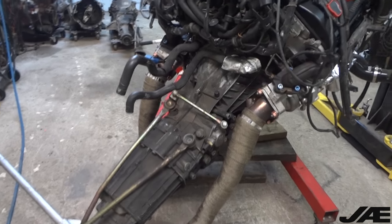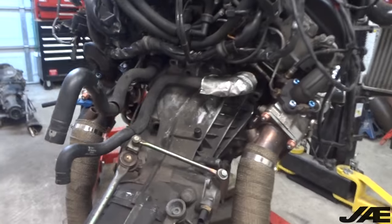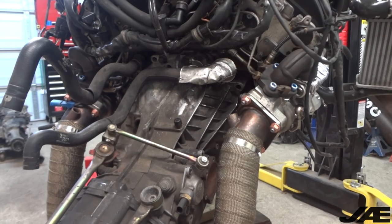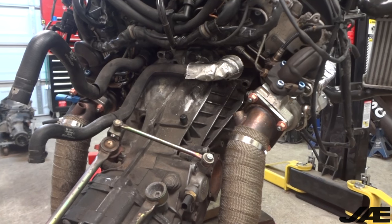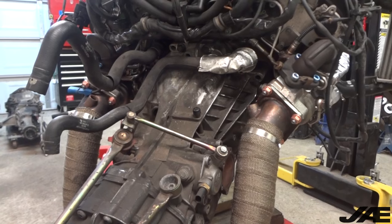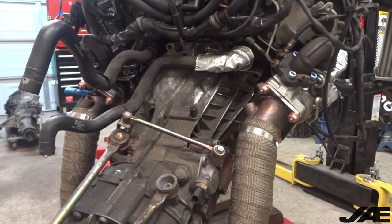The time lapse cut off early but I managed to get the transmission bolted up - a little bit of a pain but it wasn't too bad. I don't actually ever really use a clutch alignment tool; as long as it's pretty centered it seems to work out pretty well. I didn't have any problems with having to realign the clutch or anything.